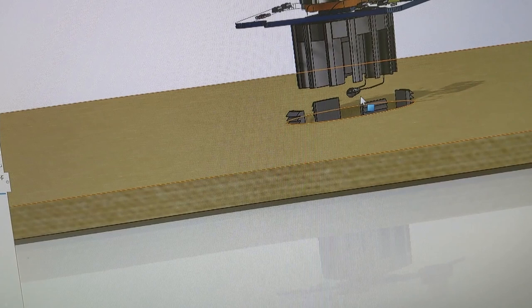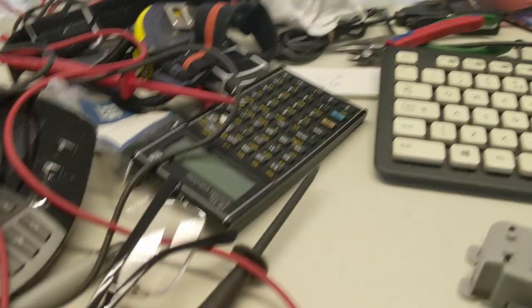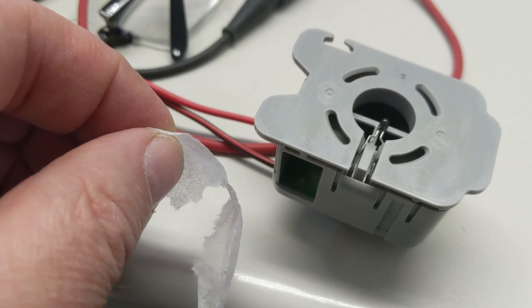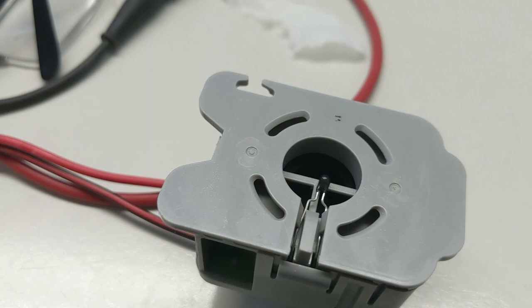All credit to GM. I've connected the fan to a 12 volt power supply — you can see it's drawing about 40 milliamps. By way of this demonstration, I've got a bit of tissue here. You can see that it's actually blowing air from the unit — sucking air in and blowing air out. If I stop it you can see the vanes there, and if I turn it on it'll just blur on the vision. So that's actually working.